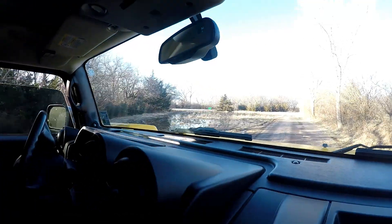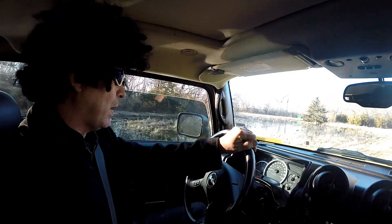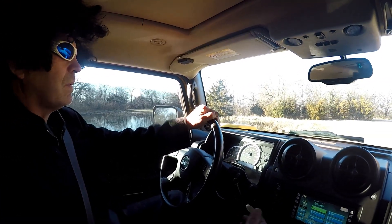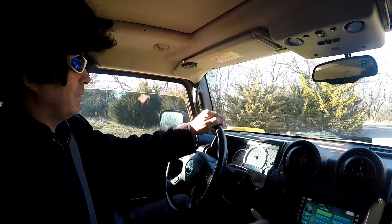We got a few little lights on the dash — it's normal because in this redline package we've disconnected the ABS at this point. We'll probably put it on a toggle for customers. We don't want ABS for sure because as soon as you start to blister a tire, the brakes try to go active and slow the vehicle down and all you're doing is burning up brakes — that's no good.